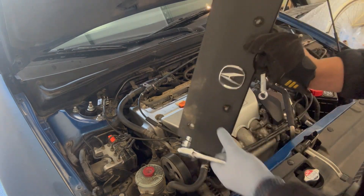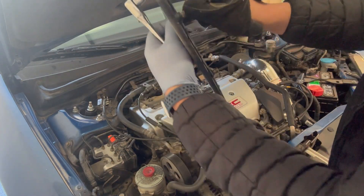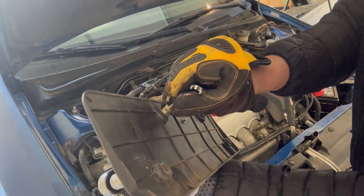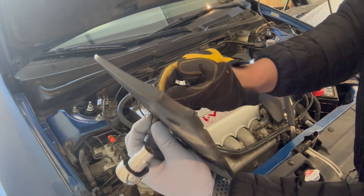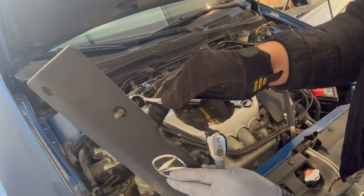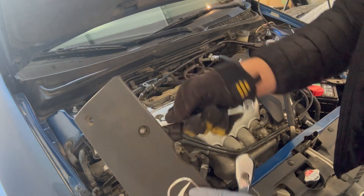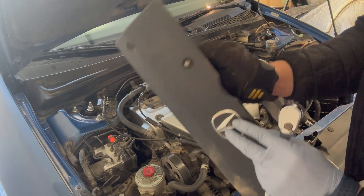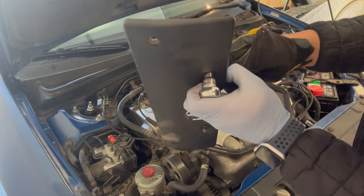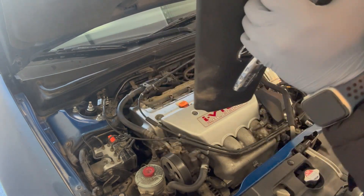This valve cover is kind of put on tight — it's over-torqued — so I wasn't able to move it from the coil plug because they're kind of connected. What I'm going to do is just break it apart, and next time I put it on I won't put it on this tight. If a previous owner over-torqued it, it's a little dangerous because you might actually crack the plastic cover.